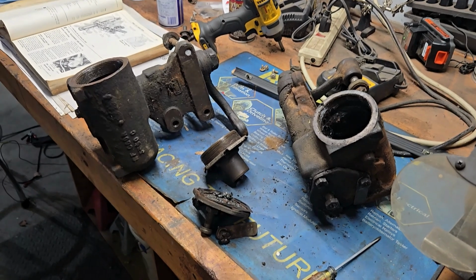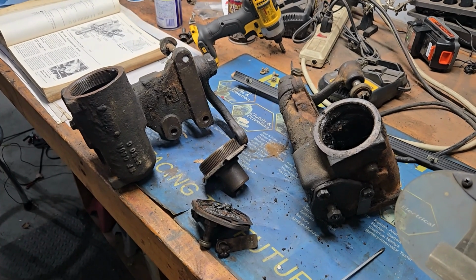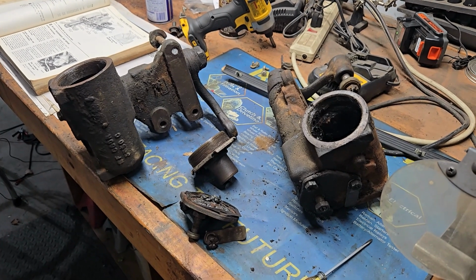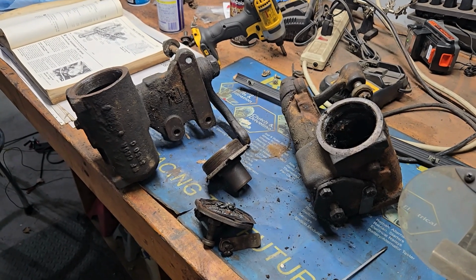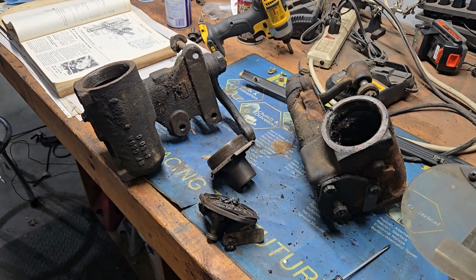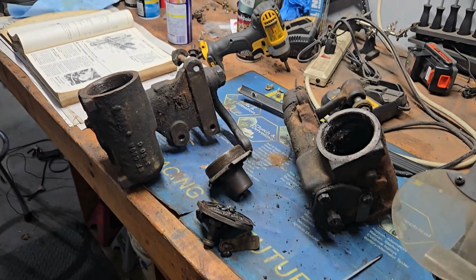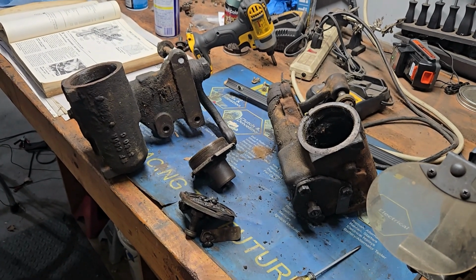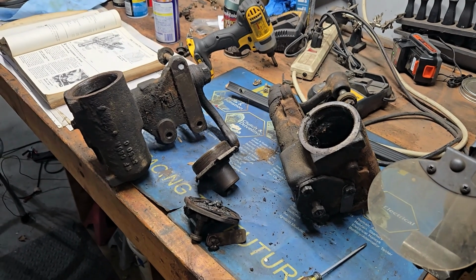It's actually not bad if you have a two-piece steering shaft, which '66 and '65 do not. So you need to source a newer model coupled steering box shaft combination, and possibly a column. I guess you'd need that too, because it probably isn't compatible. And none of that will work with a column shift automatic, because you have to shorten that steering shaft in a way that the linkage isn't going to be happy. It's pretty much impossible from everyone I've talked to.